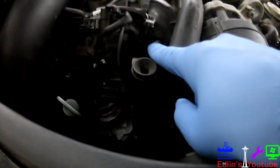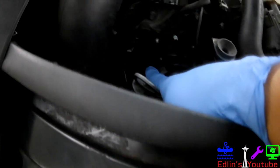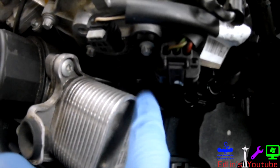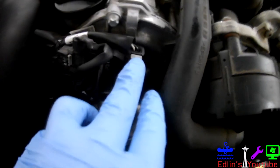I'm going to show you where the four camshaft sensor adjuster magnets are. One's here — this is the easy one. The two on the passenger side are very easy to access; one is down there. They're pretty much a triangular three-bolt setup. Numbers three and four are the driver-side ones, which are a lot more difficult to get to, especially the one behind the power steering canister. This one's not too bad with a one-fourth wrench. And this is the little gray tab — that's how you differentiate them from the other sensors.